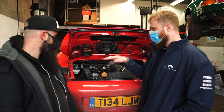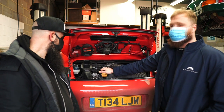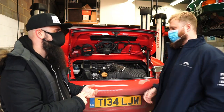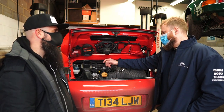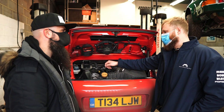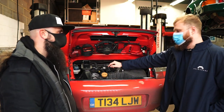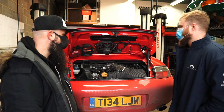Make sure the car's dead flat and cold — like you haven't run it for at least a day — and take the cap off. Make sure you're not mixing coolants. Typically here we find it's the red-type coolant. General stuff: check your oil level — that's an all-year-round thing. Keep it between min and max; I always try to keep it to the max. On your model, first thing in the morning you can do it on the dash. Before driving any of these cars, I always just turn the ignition on and check. Luckily on the 996 there's a dipstick, which they've phased out in later models. The dipstick can never lie — electronics can.